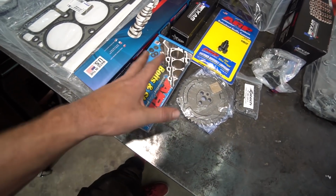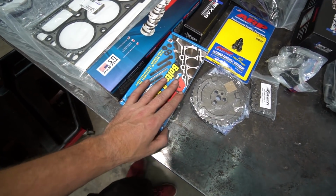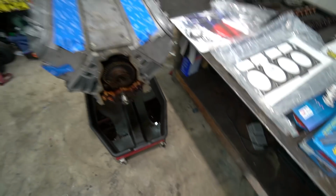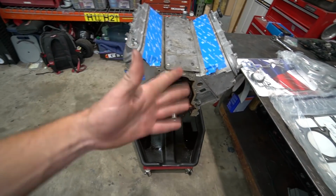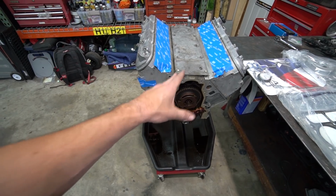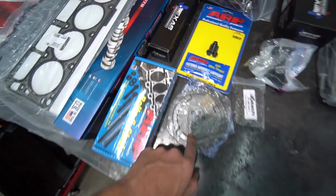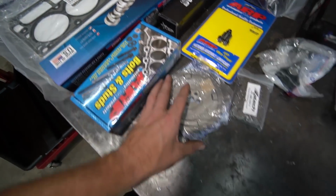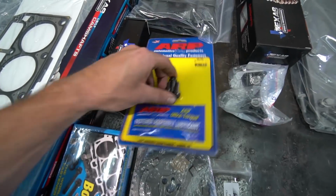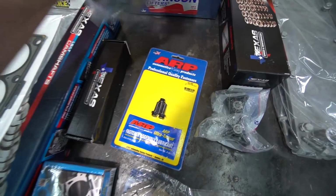Now this is a little bougie. This isn't something I normally do, but I figured we're going the extra mile with this engine. Normally I try to keep things budget, and it's more fun that way. But this is a pretty nice base to start with, and a relatively expensive base compared to some other truck motors, so I want to do it right. We have a 3-bolt cam gear, so we can use a normal 3-bolt cam. Kitech timing chain, again another bougie item. ARP cam bolts. New lifter trays.